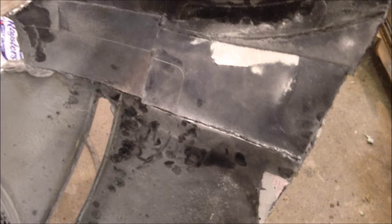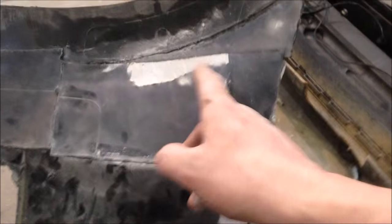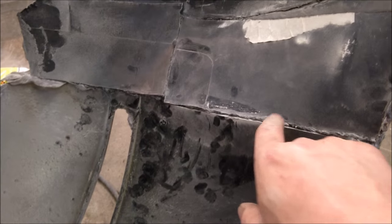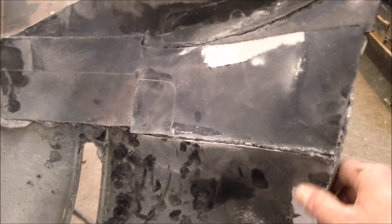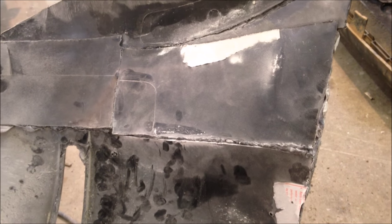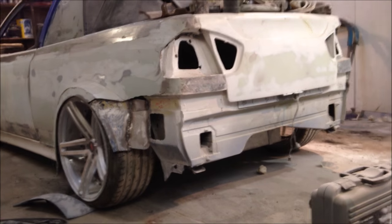You can see that basically it was all plastic welded in place. So now we've got to go ahead and start sanding everything and shaping everything a little bit better. I'll clean all this up for the brackets, and we're going to bond the brackets on with the EVERCOAT Multi Fix. Any of the joints, like here, I think we'll do, and then we'll give them a skim of fiber tech just to make this bumper nice and rigid, but still giving it a bit of flex. So that's the plan for that side, and obviously this side we've got to make now. But first thing is clean everything up and get the welding finished, the supports on, the bumper brackets on.